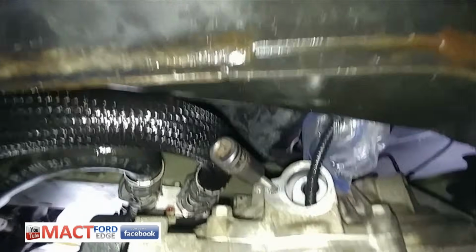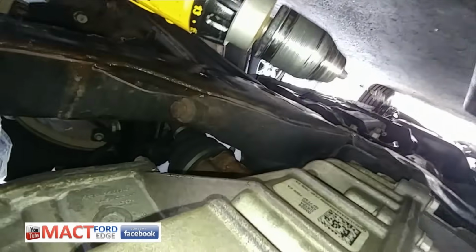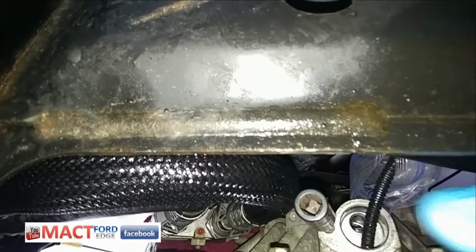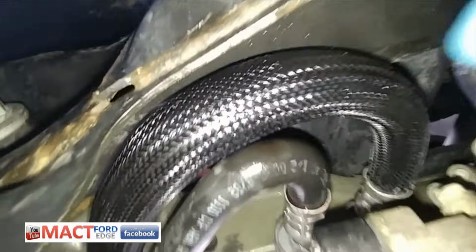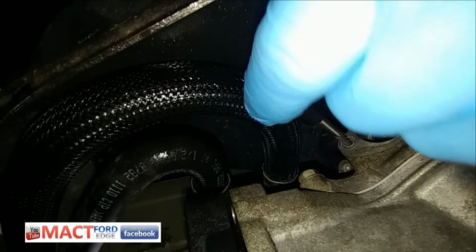Alright, it's about 2 minutes later, maybe 5 minutes. I drilled a little bit more with the nice cobalt drill bit. I can't remember what it was, 7/64 or something like that. And it was going really nice, went in there really beautifully. Decided to try an easy out, went real super slow, and check it out. There you can see it, if I can get my big fingers out of the way. There it is. It's coming out.